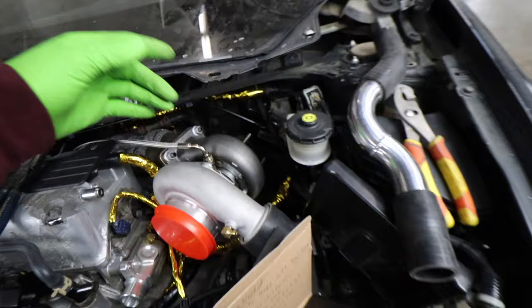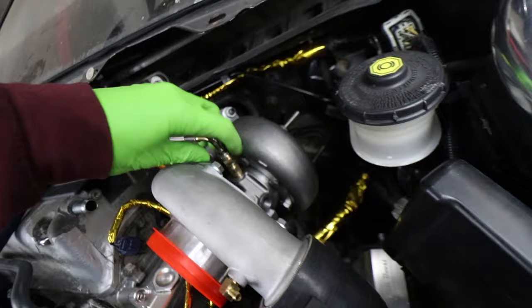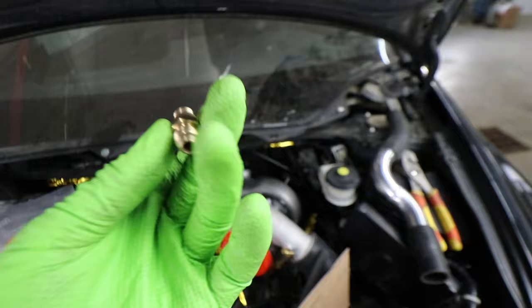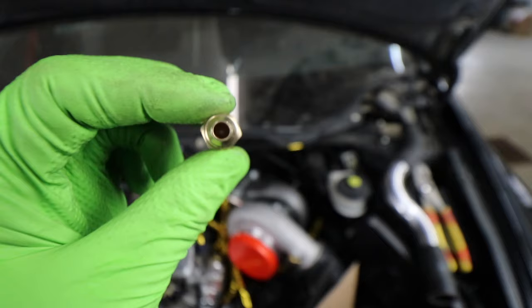Last but not least, probably the most important piece of them all, is the oil feed line. CX Racing does supply a fitting for the oil feed that goes on the turbo. I got a lot of comments on previous videos saying you need to get a fitting with a proper size oil restrictor for this turbo or else you just blow the seals out. If you guys get the ball bearing turbo — which this one is — you will need an oil restrictor. Now if you look at this fitting, there is a restrictor in there. You can see the fitting size is huge, but if you look through there, there's one little tiny air gap — and that's your oil restrictor. So this is going to work perfect.